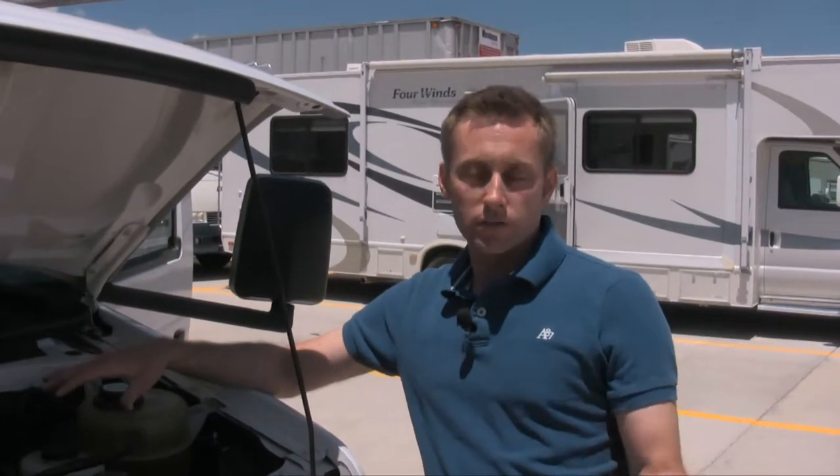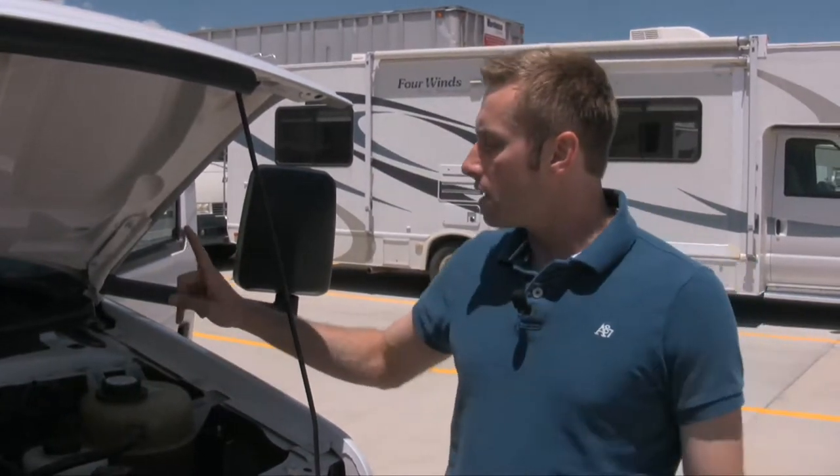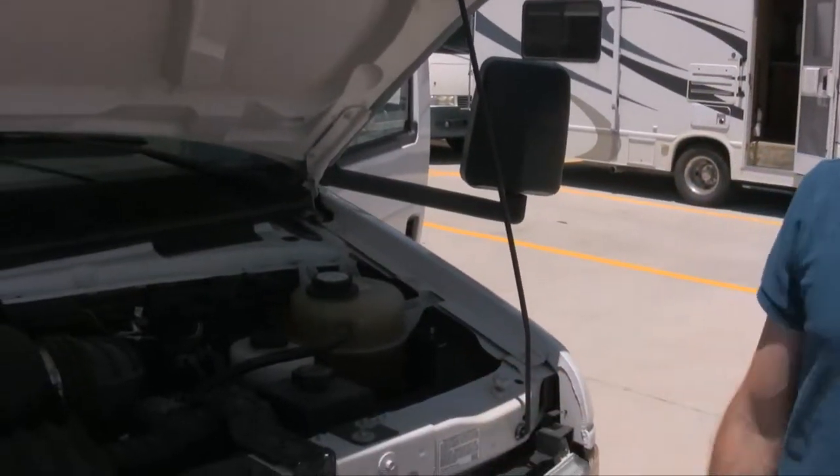It's always your responsibility. Every time you check your unit or fill up for gas, please take the time to check your oil. Always let it sit for 15-20 minutes before you check it. Everything else here is pretty standard — nothing too fancy. Let's go ahead and walk around the side.